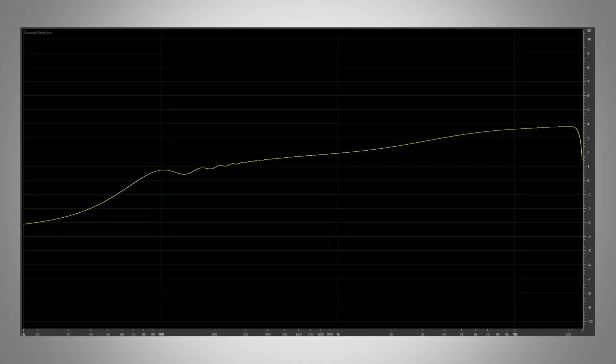I did that and tweaked it so that it gets as close as possible to the original frequency response, and this is what I ended up with. In yellow you can see the frequency response of the Air Mode, and overlaid in purple you can see my simulated curve. This is very close, with the biggest deviation being only 0.1 dB, so there should be no audible difference between the two. Please ignore the roll off below 100 Hz — this is caused by the method I used to make this illustration; in practice it's still flat there.